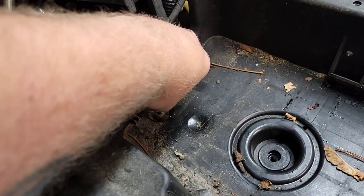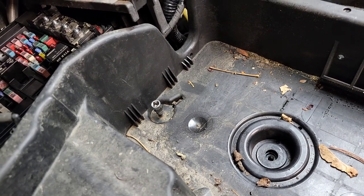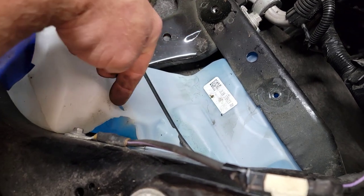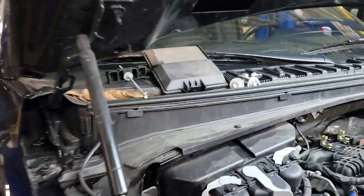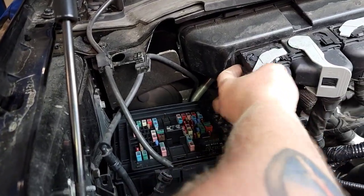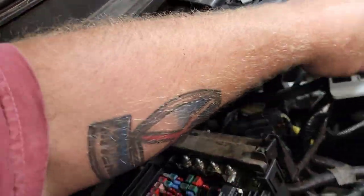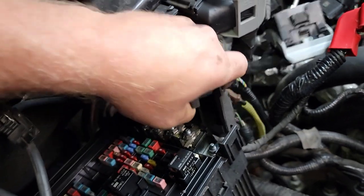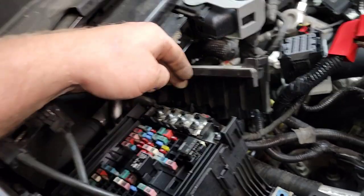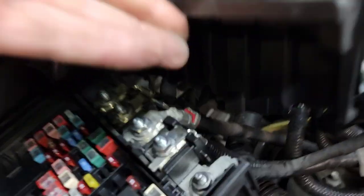There's a little T20 right here — Torx 20, the little star thing, for the people that need further explanation. This here is attached to the side of the box as well, it's got a couple of pressure tabs, you've got to be careful with that. There was a plastic push clip right here that went through the box — you've got to pull that out as well. Disconnect the connector over here: push down on the inside and then pull back on the release tab. Once you get the connector off, pull it to the side, then pull this cover off out of the way. Make note of where each one of these go and disconnect them — these are the basic power feeds for the different circuits. 10 millimeter, but you've got to make note of where they all go.